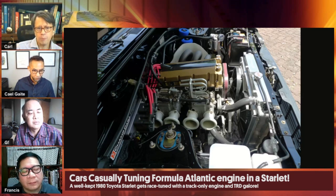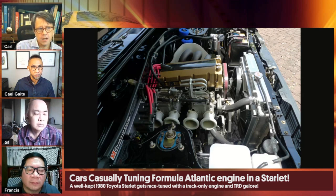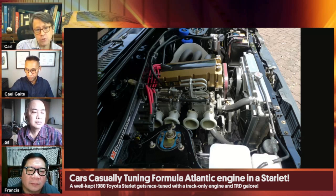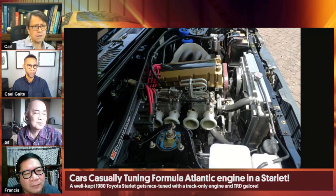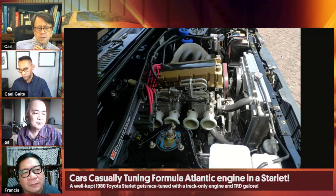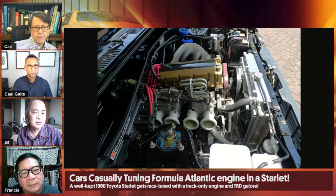Because they can redesign the car completely around only one engine, there are advantages for setting it up for safety features and for space inside. That's why we have bigger cabins inside cars now. They'll only go up to, let's say, three-cylinder engines, which are only possible now because they're no longer as buzzy or unbalanced as before. Now they're boosting everything. Everything's turbocharged. That's how they're making the power and getting the torque from these tiny little engines. Turbo and the mild hybrid system.